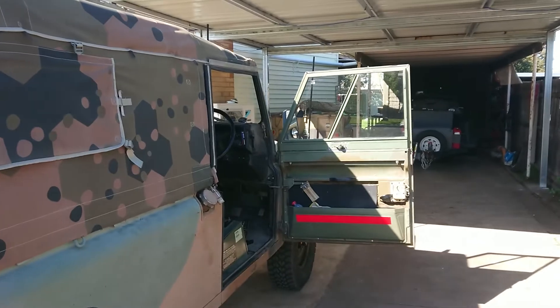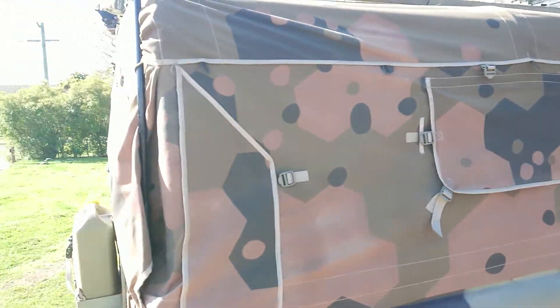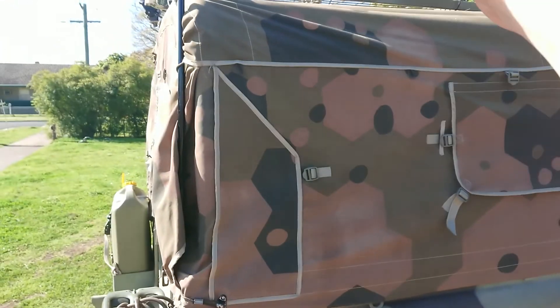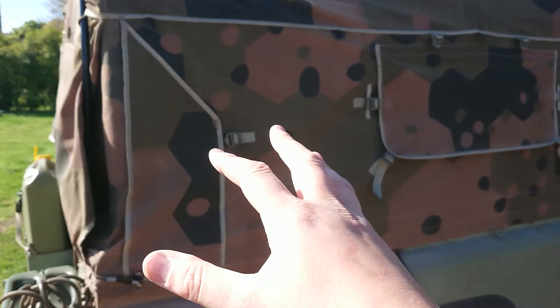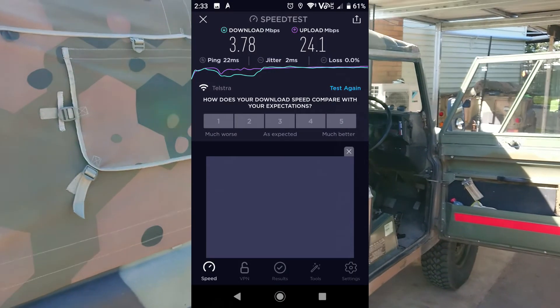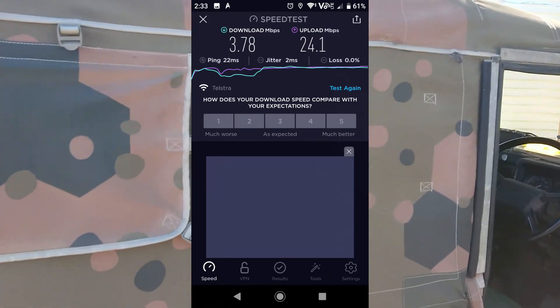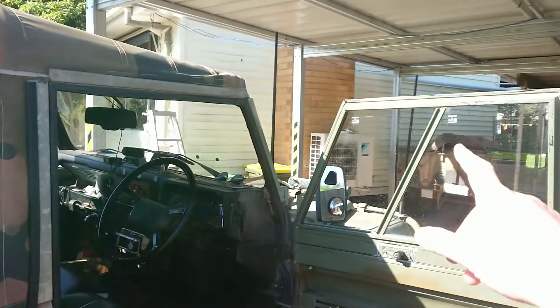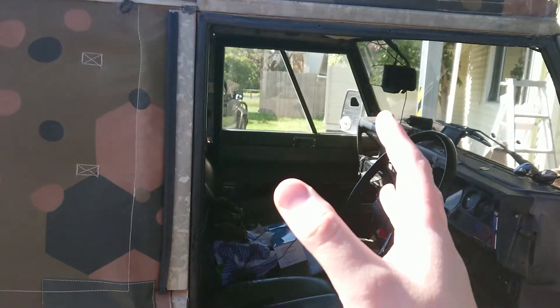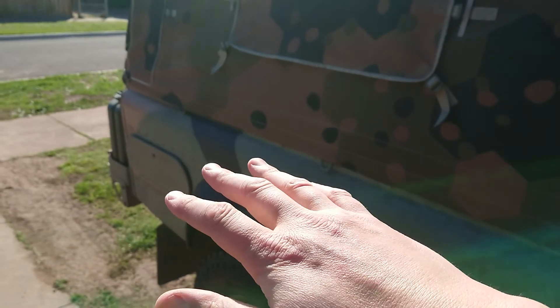A little addendum before I disappear entirely: I temporarily mounted the antenna somewhere near where I plan to put it — on this back quarter — and threaded the cable up through my cable gantries where it's nicely shielded. I got a considerably better result: nearly four megabits on the download. That's looking very promising. I think maybe having the antennas too close caused interference, but two antennas is definitely better than one, and four megabit down is about what I'd expect on my phone in this area.